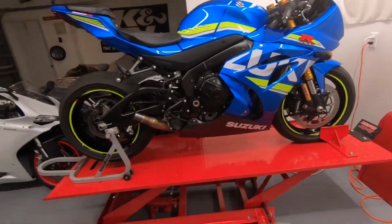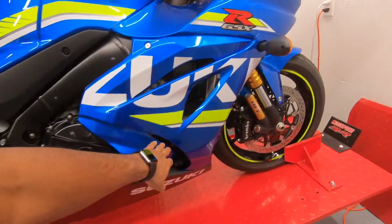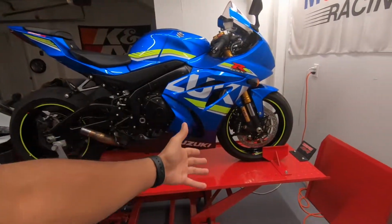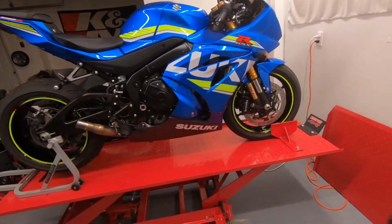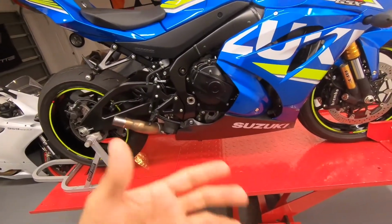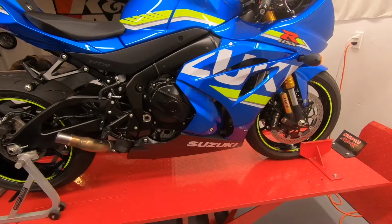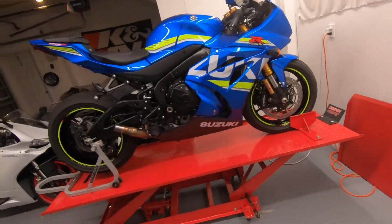But take that rear tail section off. Get all the cables out. There's another servo cable up here for the front exhaust that connects two of the primaries in between there, obviously for torque management and optimal fuel ratios and runner designs and all these other things that work perfectly well with the stock exhaust and play in great harmony. But for the new system, that's not going to be needed, and we obviously don't want any check engine lights or any engine codes or anything on the dash when we fire this thing up.